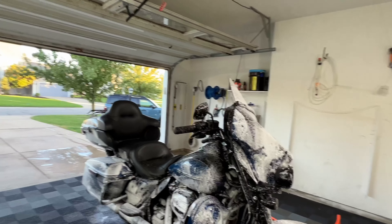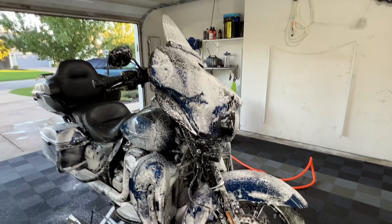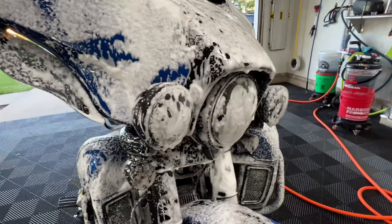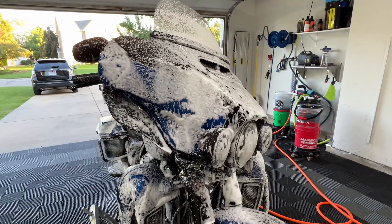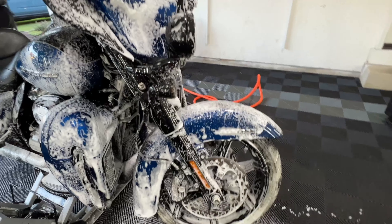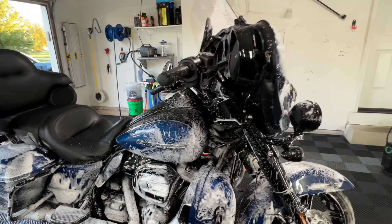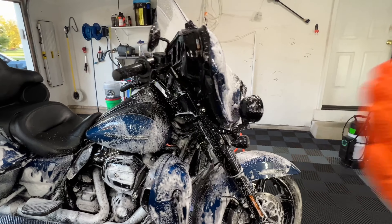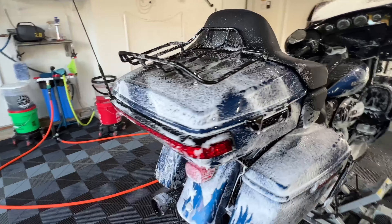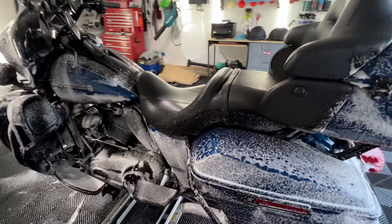A foam cannon of your choice, a foam sprayer, or a product like the IK eFoam Pro 12. When the vehicle is dry, spray your foam on with your favorite soap. This is an APC that's diluted — a high quality APC. You can see it's breaking down the grease and grime on the tires. We're going to hit it with a soap, break it down, emulsify, lift it, and rinse off the bike with a soft hose to release the majority of the dirt and grime before we go into any contact washing.